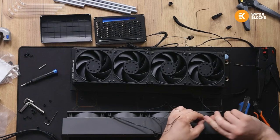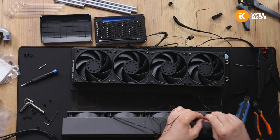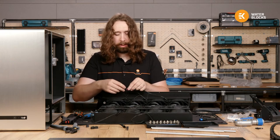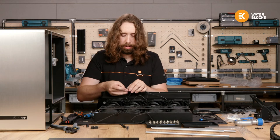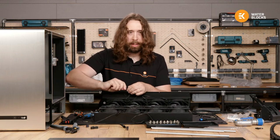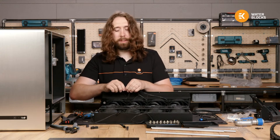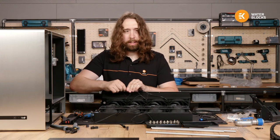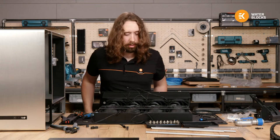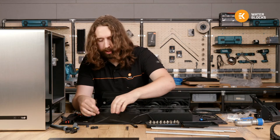No, I'm not doing it because ATX is easier to source, Joe, but because it's much easier to make, firstly, the extension back to the power supply, because it's not going from the really small fan connectors to the ATX, where you want a big wire on one end and a small wire on the other end for it to fit together. But the main reason is that they have a latch, so they don't come apart and you can be a bit ruthless with the radiator when you're trying to push it inside and you 100% know it didn't fall apart and all your fans are still properly connected. So that's the main value I see in going with ATX.